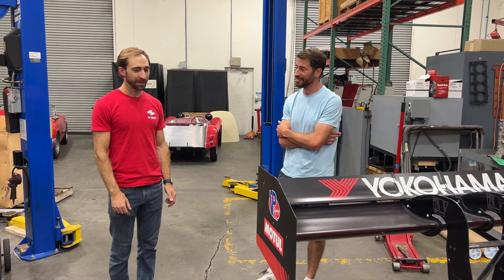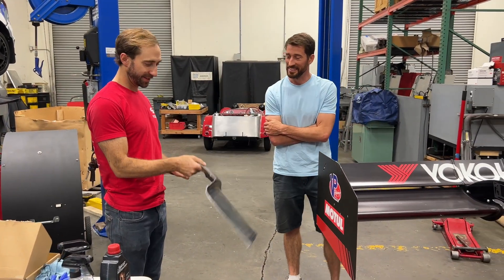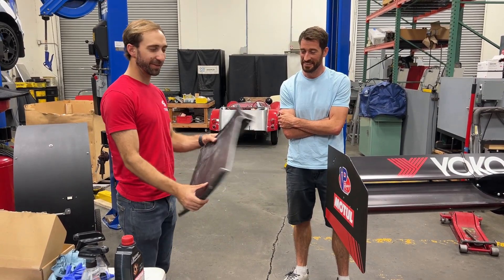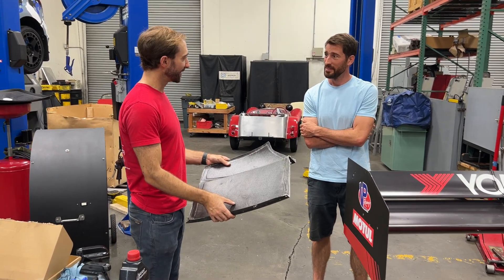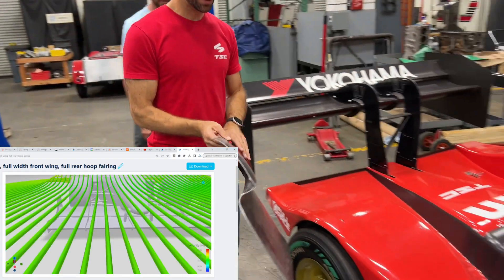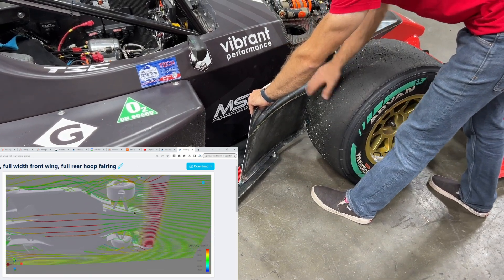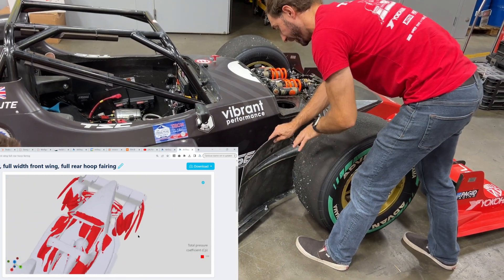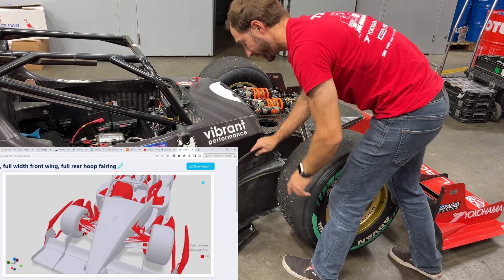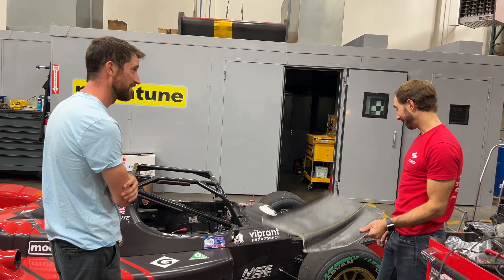As for what else we have in store — we're in the process of cutting up our wolf parts. This was the backside of the front wheel pods, and it looked a lot like a barge board. I've already cut it out — this is the biggest barge board I could make out of it, and I ran that in simulation. It didn't do as well as if it was a little bit smaller, so I optimised the shape, and this is now the new trim line in yellow, and that's going to go on the car up here in this corner. It sits in here like so, and this cleans up all the dirty tyre wake. It actually improves downforce for the car by cleaning up the airflow going under the floor, and it also improves airflow going into the radiators. The neat thing is it doesn't really affect the balance of the car, so it really is a win-win. I've got to finish making these, cut them up, put them on the car and try them out.